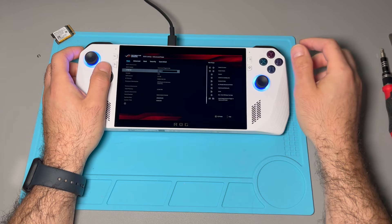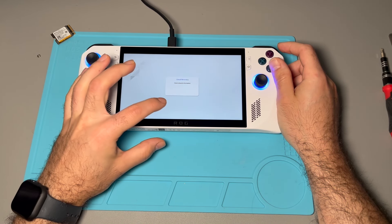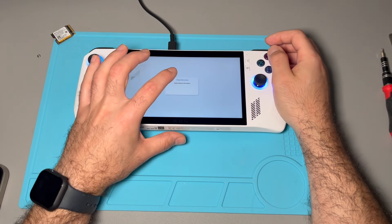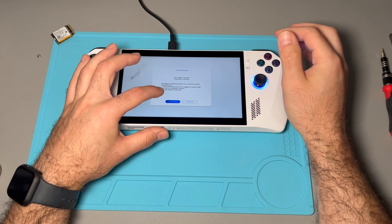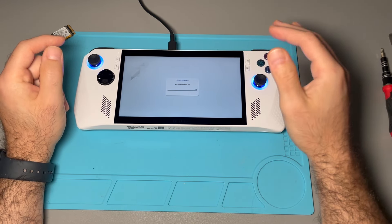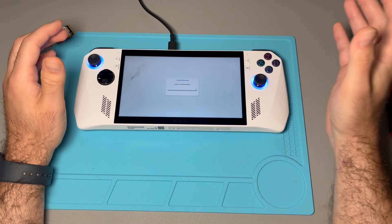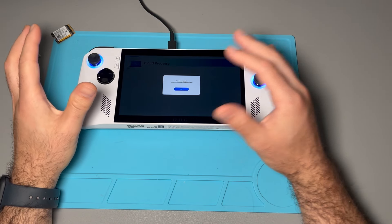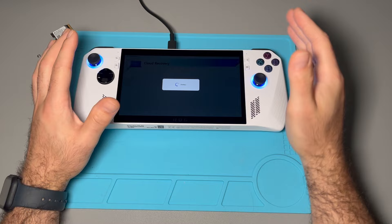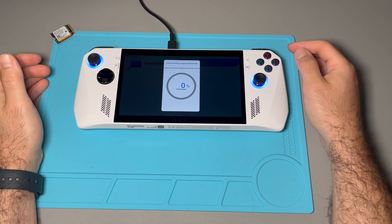We're going to go to Advanced Options, then Advanced, then ASUS Cloud Recovery and hit A to run through this process. So I'm above 20% battery — yes. Check network information, and then it's going to look for your Wi-Fi and you'll set all that up. Once connected, just go through the steps. If something pops up saying do you want to recover anything — there's nothing to recover, we put a new SSD in here. This is going to vary in terms of how long it takes. It'll download essentially everything that the ROG Ally needs. It might ask for your Wi-Fi password again, and then it'll say no update required. If it asks do you want to back up your files — no, we don't have any files. Are you sure you're going to restart the cloud recovery process? Yes. Then we'll wait for the process to finish.